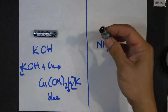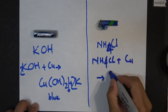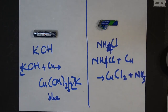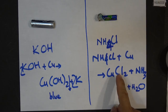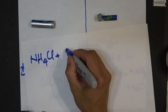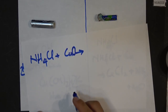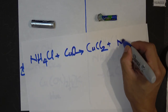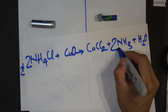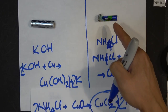On the other hand, a zinc-carbon battery will react with copper to form copper chloride and ammonia (NH3) and water. In reality, the reaction is: NH4Cl plus CuO — copper is usually copper oxide since copper oxidizes easily in air — forming copper chloride, NH3 ammonia, and water. Balancing gives us two of each. This is what you get when you use a zinc-carbon battery.